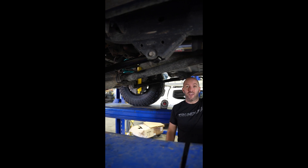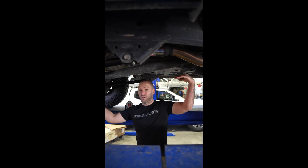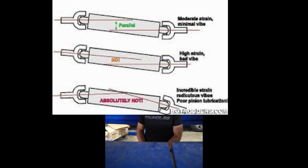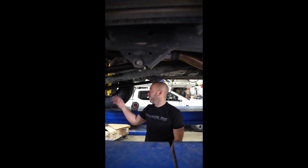So if this comes down at 5 degrees from 90, this needs to go up at 5 degrees from 90. We'll put a photo up in the top right so you can have a quick look at that to get your head around it. There are a lot of options — adjustable lowers, adjustable uppers — that's how you adjust them. A lot of guys seem to be pointing the diff at the gearbox, but that's not how you do it. You'll end up with that differential in speed. Any questions, drop a comment below. If you think we're wrong, tell us how you understand it.